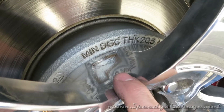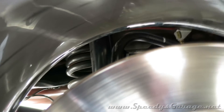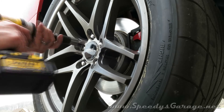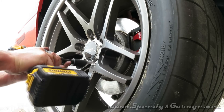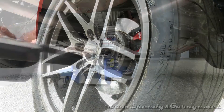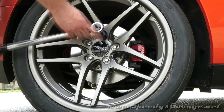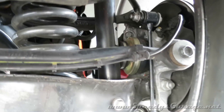As you can see, our race wheel is now fully seated on the hub, and you can see we are easily clearing the sway bar by about a quarter of an inch. Mission accomplished. Now reinstall your wheels and snug the lug nuts down, lower the car, and torque the lug nuts to 110 foot-pounds. With the car at ride height, inspect the suspension to make sure nothing's making contact, and then go for a test drive to check your work.